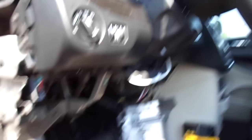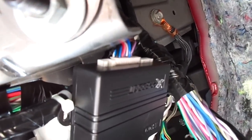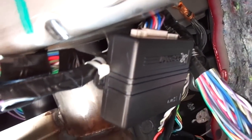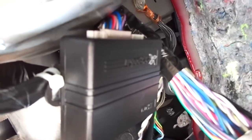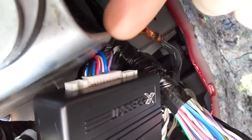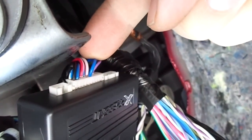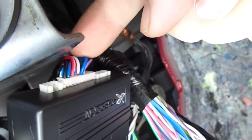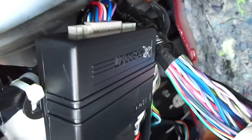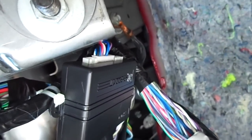There's the dashboard. This is our XK09 and harness. You didn't really miss much on the harness. There are the two plugs that plug in, and then there are three extra lines. One is this purple line here, the next is this blue. These are two of the three that are extra on this harness that we'll be using. The yellow with black line we don't use, so I pull it out.